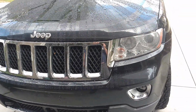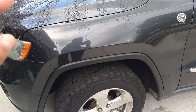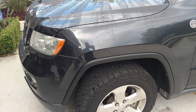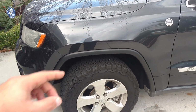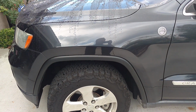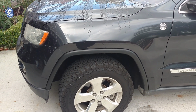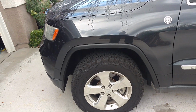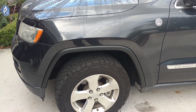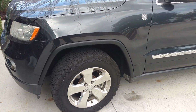So that's about it, guys. I just wanted to update you. If you do have a clunk, upper control arm, definitely check that out, especially if you're up in the higher mileage. I would say 75,000 miles or higher, because this has been going on for a long time, guys. I'd say warranty coverage, we're looking at like 12 grand in parts that they've installed looking for that clunk after all said and done, and over a month in the dealer for that. But when it's under warranty, there's nothing you can do. You just let them do it, otherwise it's all out of pocket.